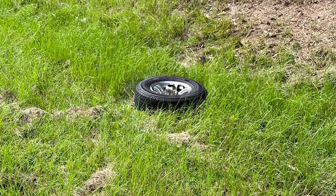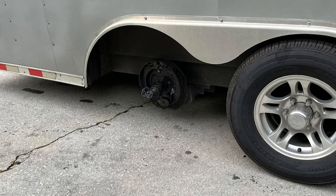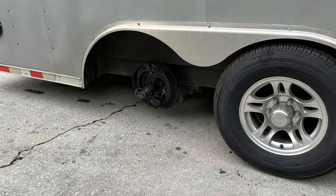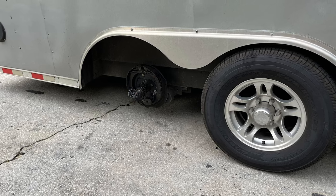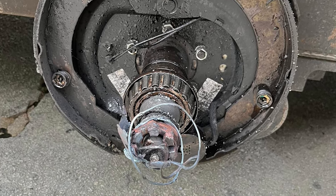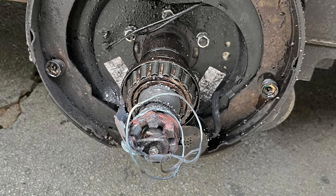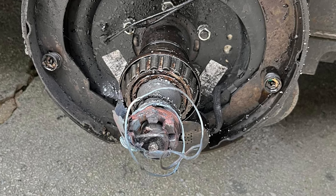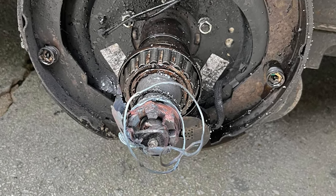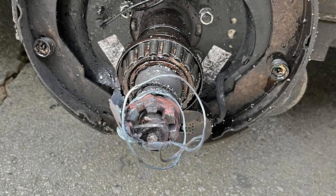And that's what you don't want to happen. As you can see in these pictures, it is possible to lose your entire wheel — and all of a sudden your four-wheel trailer is turned into a three-wheel trailer. In this particular example, that's exactly what happened. This particular trailer has a fitting on the end that injects grease back into that race, but obviously there was not enough grease in there to get the job done. Eventually that outer bearing failed, ate away the locking nut — even though it was still held in place by that cotter pin — and the entire rim came off. That is more than just a big pain. It's extremely dangerous.